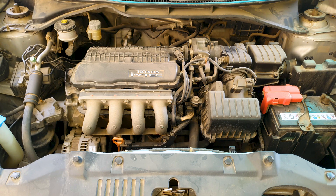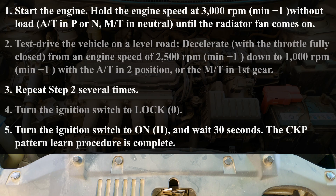If you have replaced a faulty crankshaft position sensor, you need to do a crank pattern learn procedure. With a proper diagnostic scan tool, you clear the old crank pattern data, then do the relearn procedure. Without a scan tool, there is a manual learn procedure mentioned by Honda. It doesn't mention anything about clearing any old data. I would, however, clear any error codes first, disconnect the battery for a while, or clear it with a cheap scan tool.